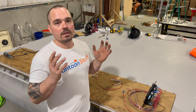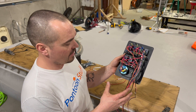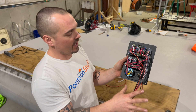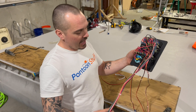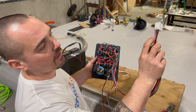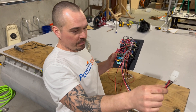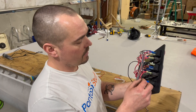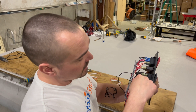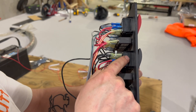All you have to remember is to give those accessories a positive and a ground. Here's the practical part: folks look at a switch panel — this is a pre-wired one from Pontoon Stuff — and they get scared. It has a charger and a volt meter; ignore those for now. This would plug into the main harness going back to your battery. There's a big red and a big black wire — picture those coming straight from the battery. There's a fuse at the battery; these big power and ground wires come in, and the red power wire comes in to a fuse and then transfers power from the fuse to a switch.